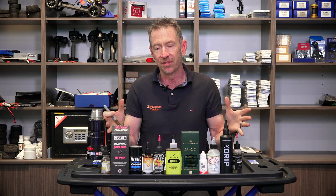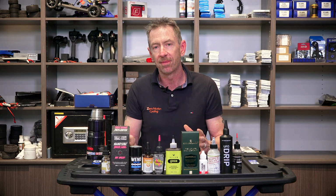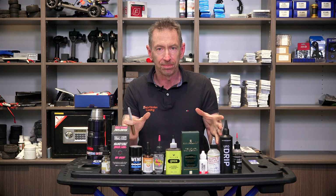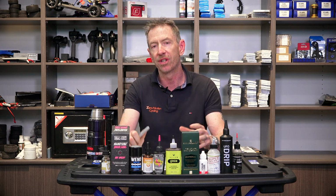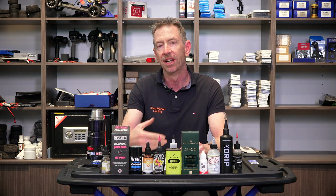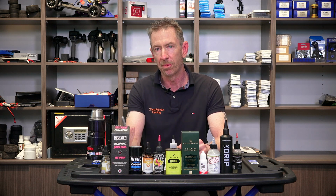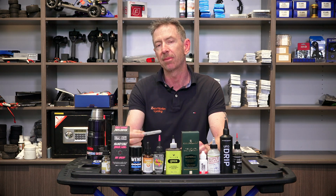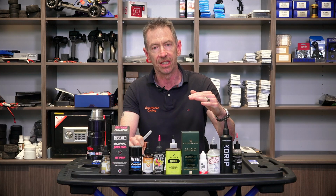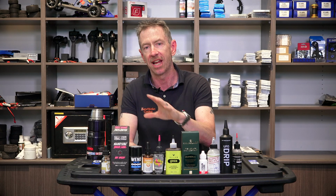So as we've gone over the journey of zero friction cycling and the testing and the stuff we do, what makes a great lubricant is one that starts off with very low efficiency loss, and is able to remain low efficiency loss by not having contamination stick to the lubricant, become part of the lubricant, and increase the lubricant's abrasiveness, which obviously increases its friction and wear. All of the top lubricants, the key secret behind them is that they're able to resist absorbing contamination and rapidly increasing in friction. They stay super low friction for a very long time by keeping the contamination out.